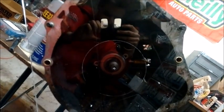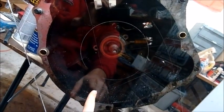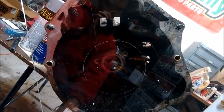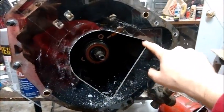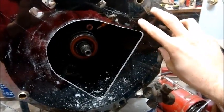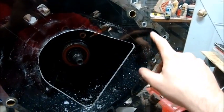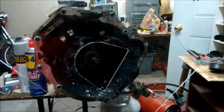Here it is — you can see that would be about vertical. I've rotated the two points for the end of my 7-inch cut across the bottom around to about 18.5 to 19 degrees. You've got the 6-inch hole here to cover that, and across the bottom near the oil pan I've got my three holes in for the starter bolt. I'm going to cut this out and insert the starter to see where it fits along the outline, so that when I bolt this up to the engine I can make sure the starter can be in its place and not hit the oil filter or anything like that.